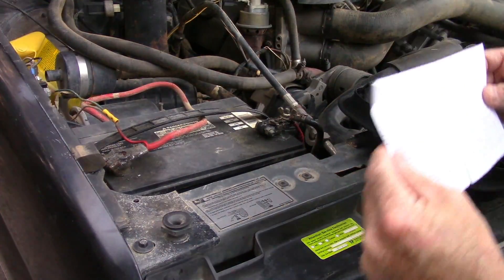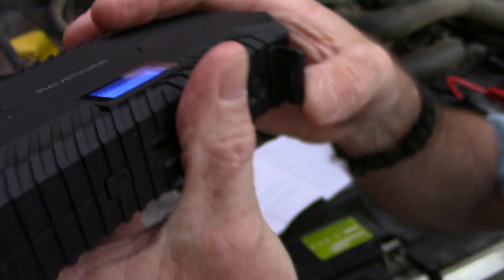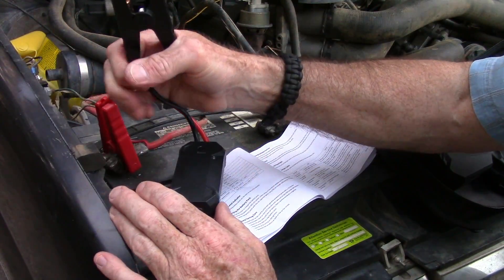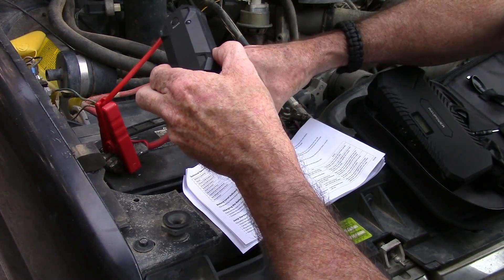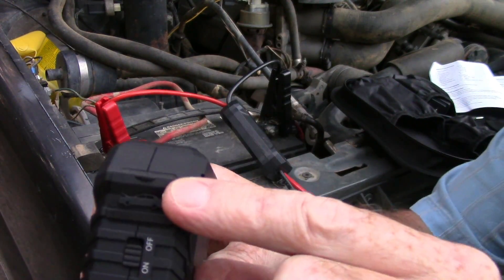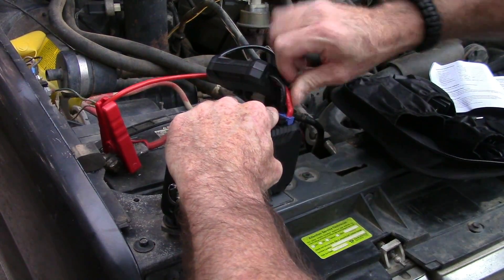Okay, the battery's over here. So what do the instructions say to do? First it says to check the battery level on the LCD indicator - it's got an on/off switch. You turn it on and it shows we have a hundred percent. Then the next step is to take the alligator clips, the jumper clips, and connect them to the battery - red to positive like so. These things open up really big and have a very positive contact. We'll clamp the other one on the negative. Then it says to plug it in and go crank the car, and as soon as you get it cranked, disconnect it. It's got a little rubber cover here with a picture of a car - pull that down and it's got your connector right there. There's only one way to connect it, so plug it in and let's see if this thing will start.